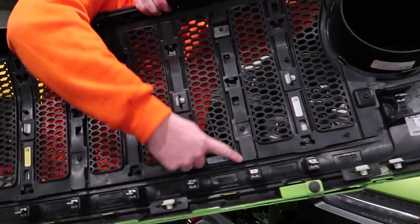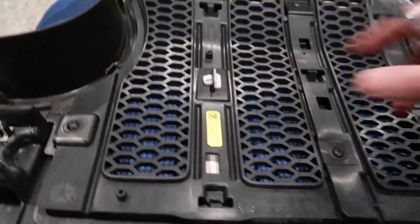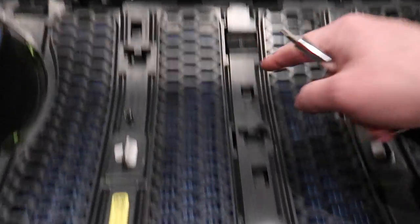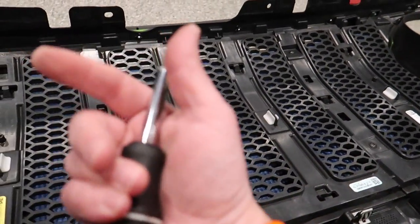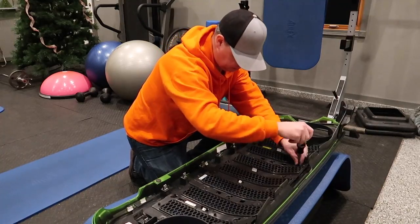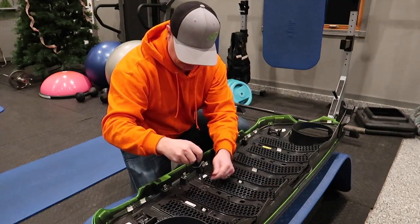Just to show you real quick — there are tabs at the bottom. Once you get those plastic clips out of the top, it's just metal tabs along the bottom that you're popping out. On the back side of the grill we're going to try to get this whole plastic insert out. It looks like these are going to be T20s — I should have four of them. The center section is also overlapping, so I may have to undo all of those as well. I'm going to go ahead and do all four for the center section. There's some other tabs and stuff to figure out, but it shouldn't be too hard once we get the screws and release the center piece.